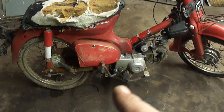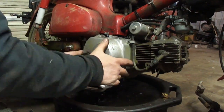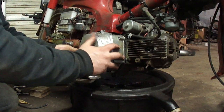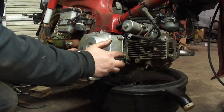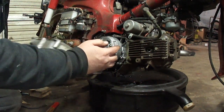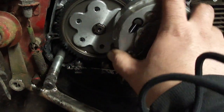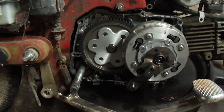I got the exhaust off and I was taking the foot pegs off — the kickstand is part of the foot peg assembly and I can't take the side cover off until I take that off, so I've got it strapped to the ceiling. Let me see if I can get this cover off now. There's pieces falling — that's not good. Took a little bit of convincing, but it's coming off now. It might be the clutch adjuster falling out — yeah, that's what it was. Doesn't look like the problem's on this side. Maybe I'll just dig all the way into this thing.